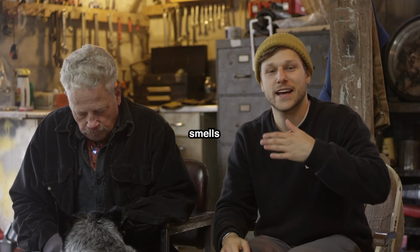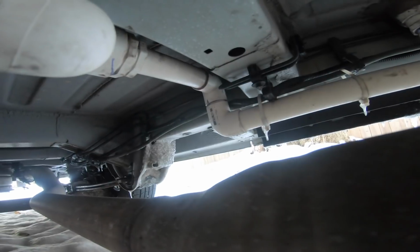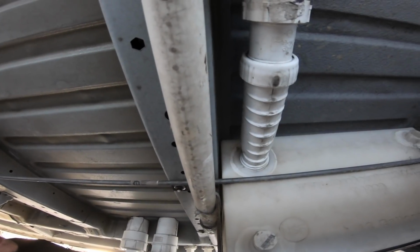Oh yeah, it was a horizontal one. And it keeps the smells from coming from the gray and blowing back up into it. And so you need to have your lines meet there to go into the tank. Having it go up at the shower there isn't ideal, but we had to have it go in at the top of the tank, and since it's gravity fed, we had to make sure everything got up there to go in and then feed down and go through here.